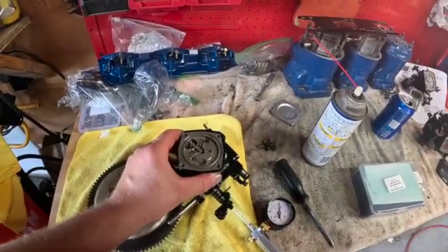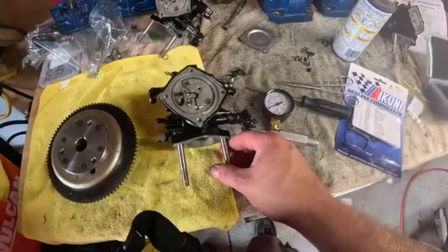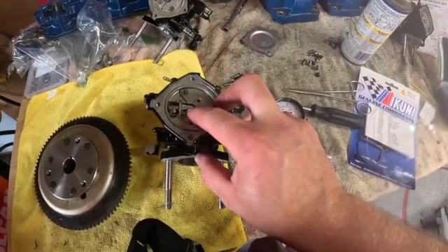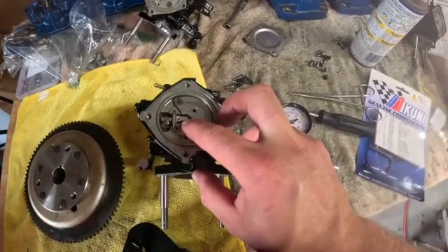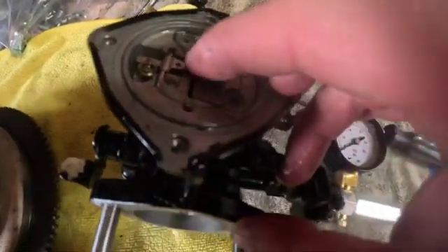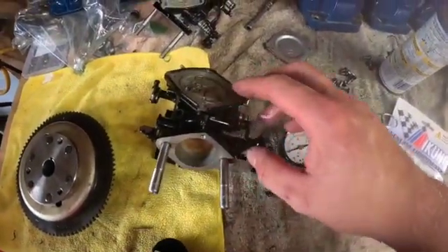Let me check the manual, let me see if this is right. I'm going to run with my pipe and everything else — I'm looking for about 18 PSI pop off pressure. From a forum I've been reading, that's just what I'm going by, so we're going to start there. What I did is I bent the metering lever down just a hair — you don't want to go over a millimeter. I was starting at about 15 pounds; you can see it's almost just a hair under flush. It's letting that needle open nice and good. So I'm going to do that with the other two and set them at about 18 pounds, and we'll try it there to start.